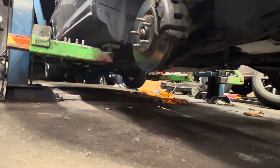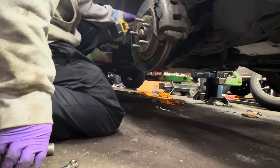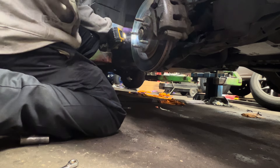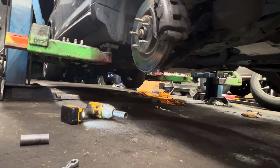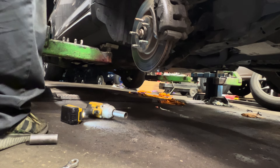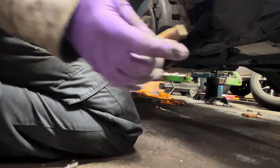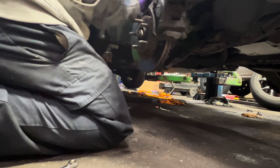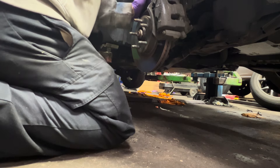A different angle — that was front, that was back, this is front. We will not kill our tools. Grab a hammer. Usually you don't hit the end of the bolt with a hammer, but this one has such a shoulder on it that we're not going to damage it. Worst case if we do, we can grind it off. See that half-inch shoulder? Leave that attached while we do this crazy brake line.